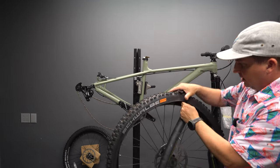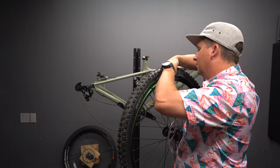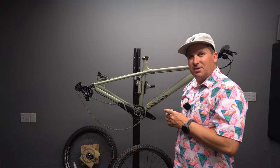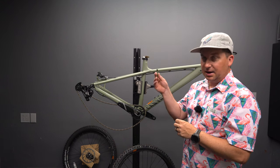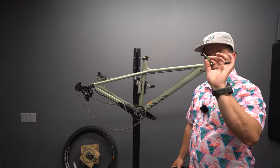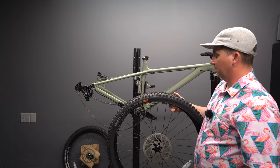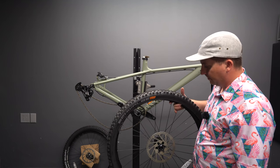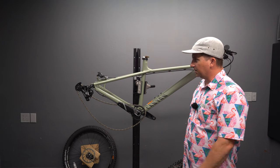Just save them this hassle. I hoped the rim strip was truly tubeless compatible, but the rim is not taped — it's just got the plastic rim strip in it. That means you're going to have to go to the shop, buy tubeless tape, buy valves — that's going to be about $40 when Canyon could have done it for $2 per valve. If you're running a Pike, you're going to be running this tubeless. I'm not willing to put my tape on here just for the review, so I'm going to run it tubed. That's one thing I'd recommend they change: include everything to make this tubeless ready. At least it's a tubeless-ready rim and tubeless-ready tire.